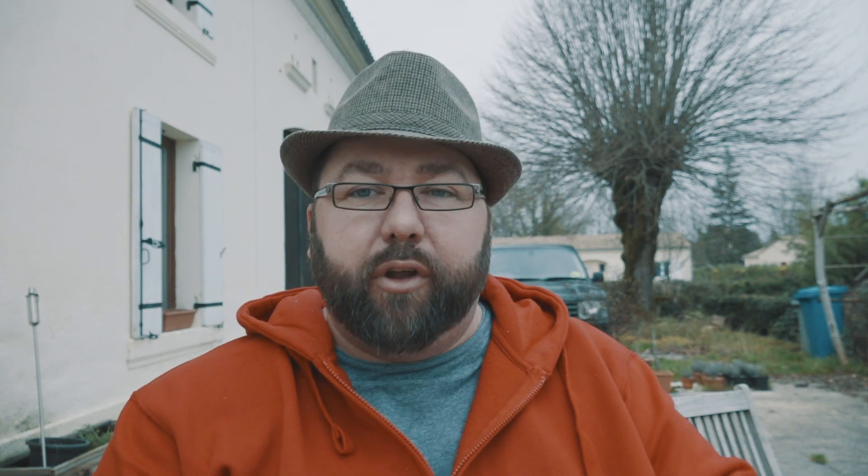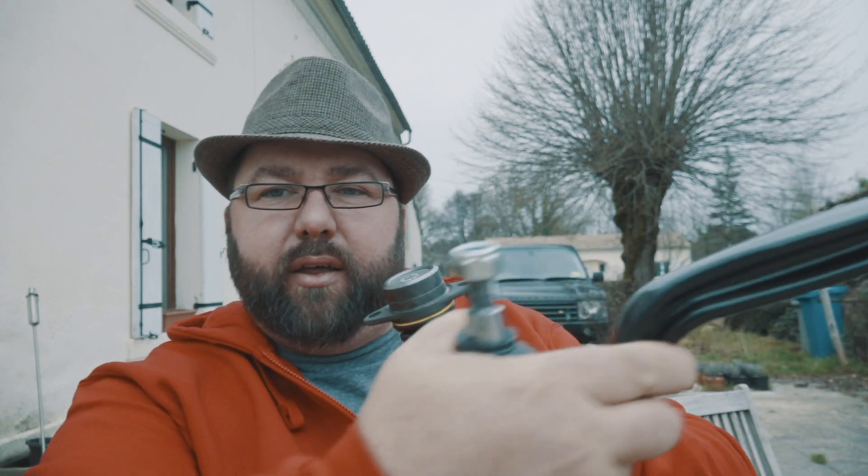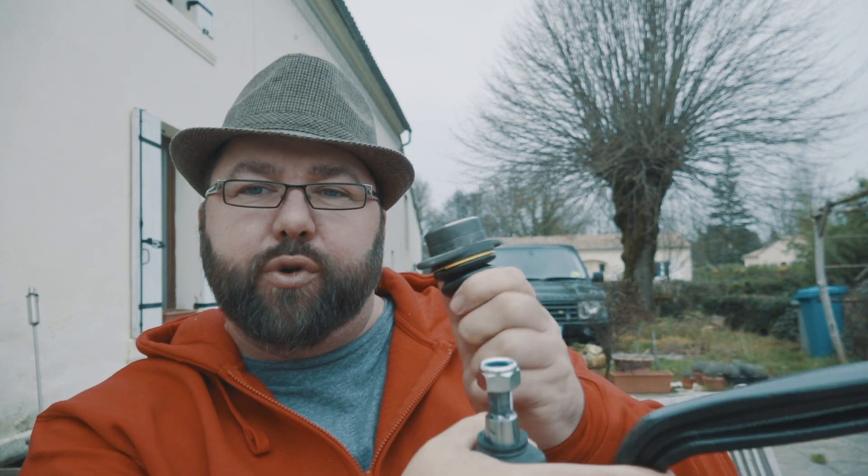Today — you might remember a few videos back when I was explaining about the Range Rover that had been in for its control technique. It failed on excessive play in the ball joints. On the Range Rover you've got two ball joints: the ball joint connected to the lower arm, and then the ball joint that goes into the lower control arm at the front, which bolts up into the hub assembly where the track control arm comes up to.